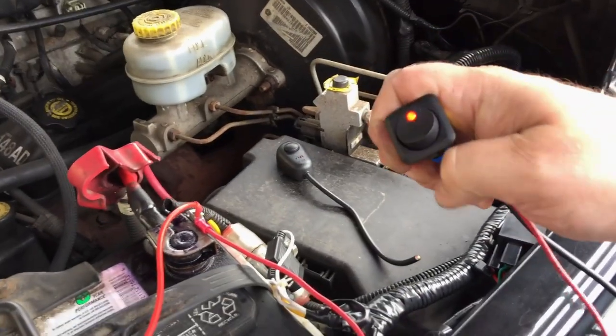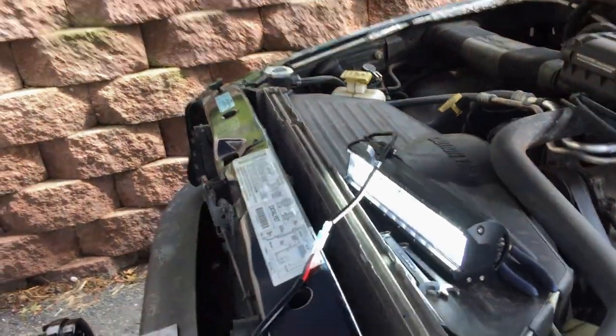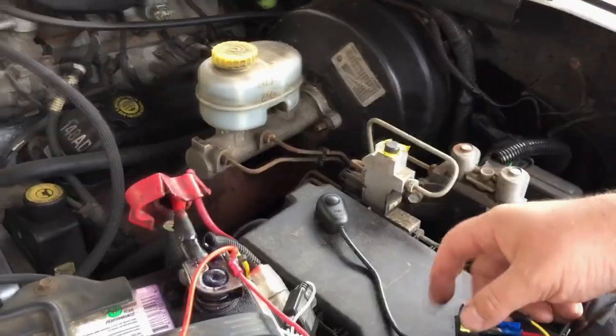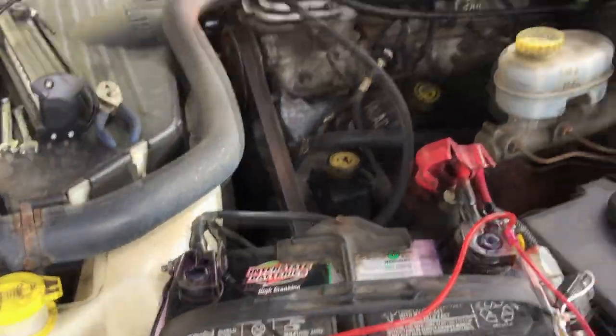Now when you turn it on, it's on; when it's off, it's off and there's no light on. Let me wedge this in here - okay, so: on, off. You see how the red light shuts off? Perfect. So there you go - that's how you upgrade the aux beam harness switch. Bottom line: you're going to use your red, you're going to use your black. Take the yellow, cut it away from the harness, throw it in the garbage. Unplug it, splice your ends onto the switch, and put it on.